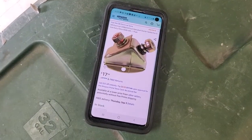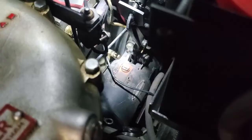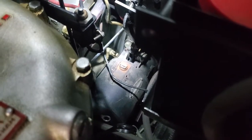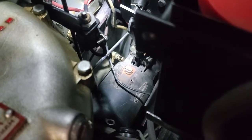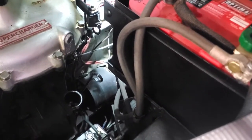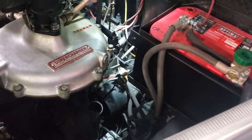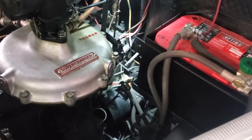You notice the starter turns over now. The copper button on top of the starter has been filed a little bit too — that's right in the center. You want to take off the rough surface so that you have two mating surfaces that actually work. Next I'll install the switch back on to the starter and we'll start the car. We've got it all back together. I'm going to turn the battery on and start the car — I didn't put the oil filler for the supercharger back in yet, but this is just to deal with getting the starter working.